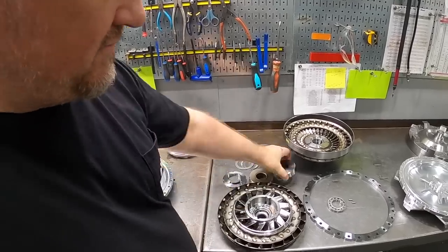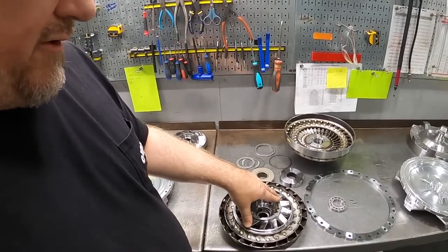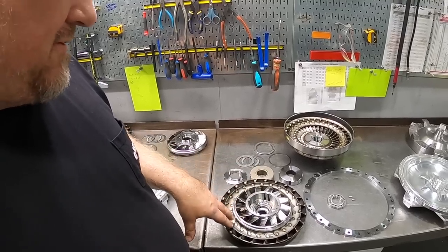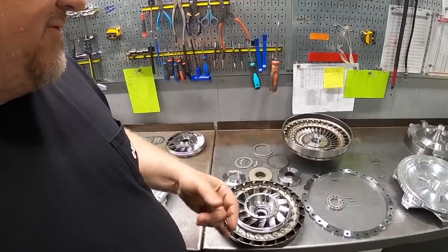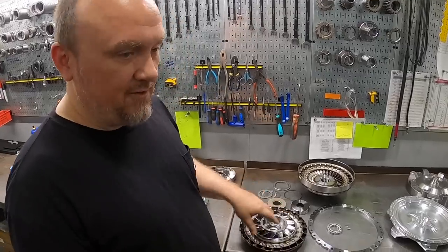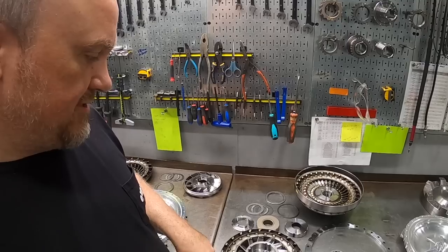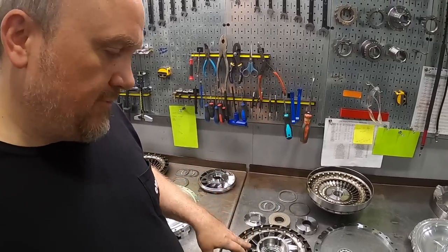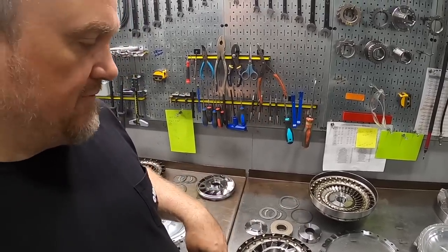That being said, with modern stator designs and our ability to manipulate fluid flow characteristics, as long as you have adequate transmission cooling in the vehicle, we have many, many examples out there of spragless converters in street cars, drag and drive cars, even heavier truck applications that are still able to maintain adequate transmission fluid operating temperature in spragless conditions. So at that point, at least specifically to our 252 millimeter product, the diode versus spragless debate really just comes down to personal preference.